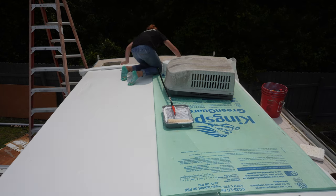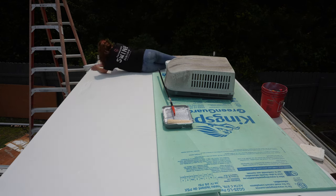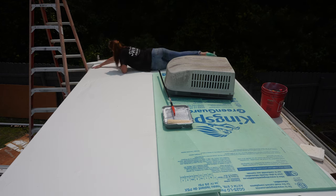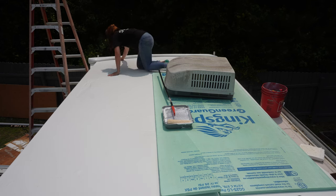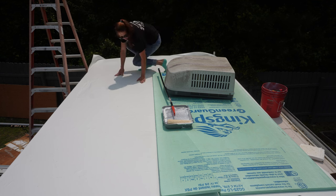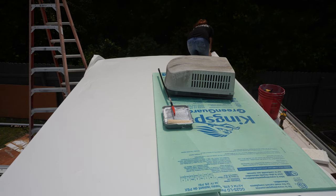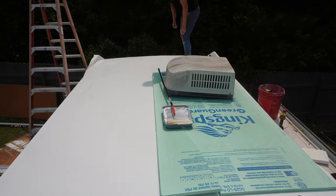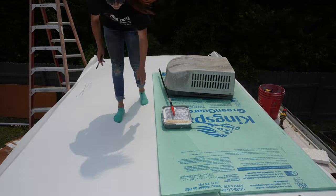I'm on the other side of this skin now — obviously, if I walked any further I would walk off the roof and we don't want that. Just be careful where you lay and what you do, especially with these back parts because there are two vents right there, and it gets really hard to see once you actually put the skin on. I'll also get a Sharpie and write a giant X where your vents are so that you don't accidentally step on them. I just got a razor blade and cut around the roof vent at the back so the skin can lay flat on there.